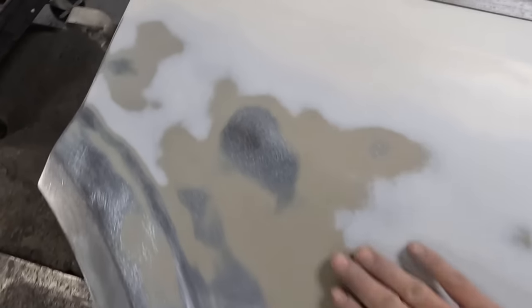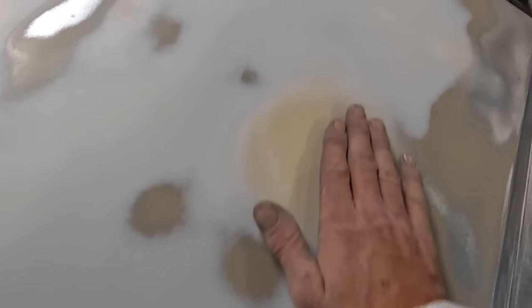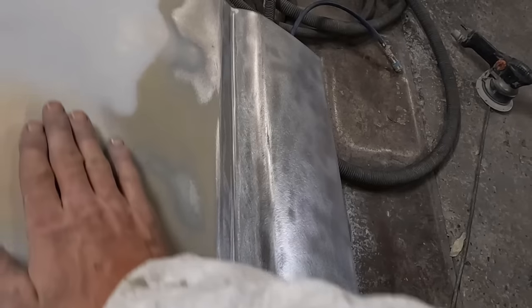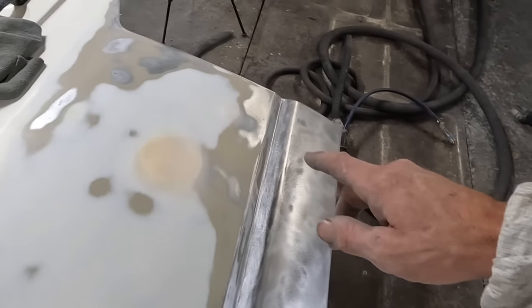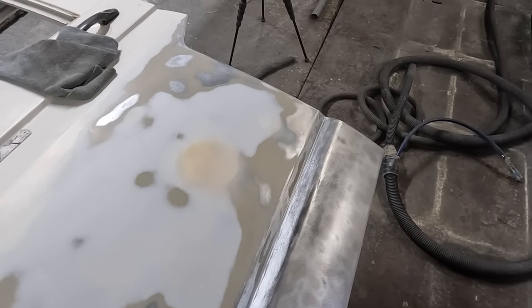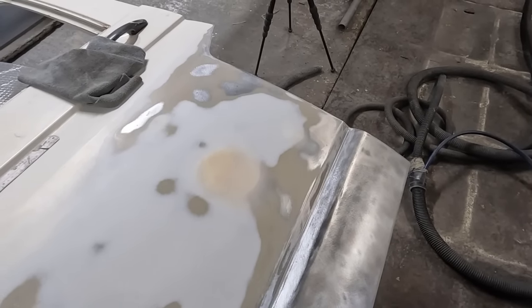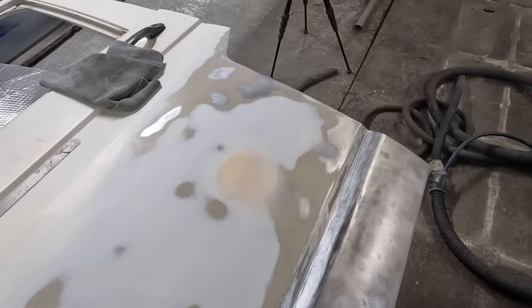I fixed the other dents - very light little bits, very small. I then blocked it all over with 180 and gone over the whole panel with 240, feathering out the transition between paints, bare metal and filler. That feels absolutely busted. Remember when you're feeling something: use your fingertips, your paws and your palm, run it all the way over slowly. If you can almost feel it but don't know where it is, look away and rub it. You'll feel it.